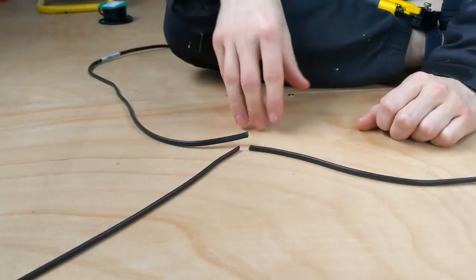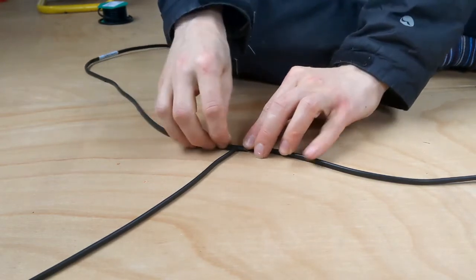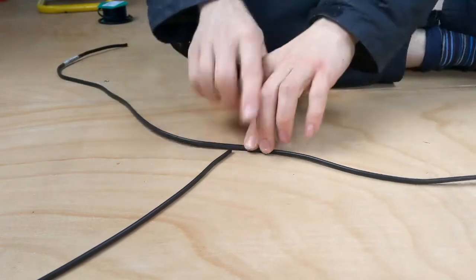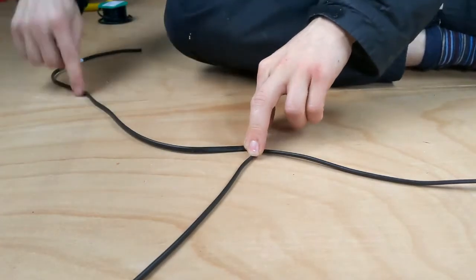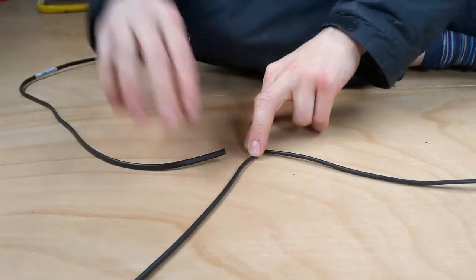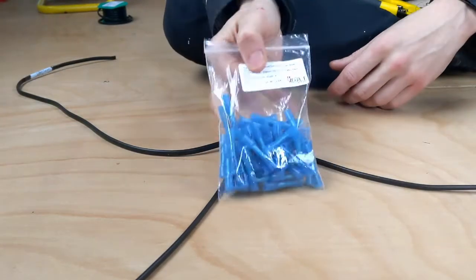So to finish up the wiring first fix, we need to do something to get all our lights wired up. We've got kind of like a donor cable almost, and that's this 1.5mm cable. And then at each of our lights, we're going to shoot off a little T-junction, and then another one at another light. And then the end one will just connect straight to the light, just for simplicity. And so we need to wire them in parallel, using our butt connectors.